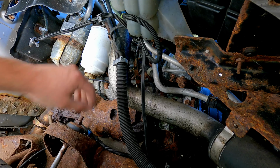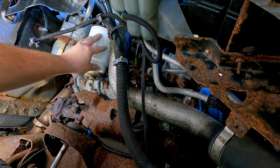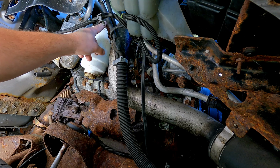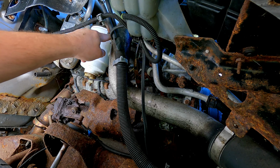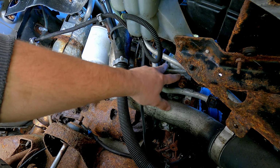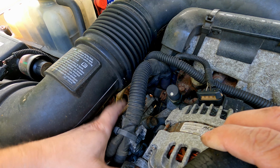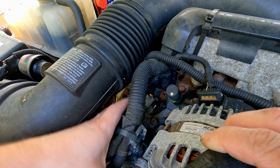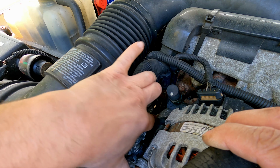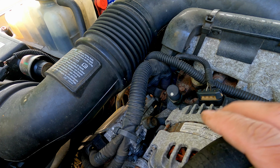Well, we're up underneath the wheel well now, and here is the fuel filter assembly, which is really nice and easy to get at. Here's the line that I was originally going to tie into, but unfortunately I'm going to have to change my plans, because that line comes down, goes behind here, and then hits this banjo fitting, which is some kind of electronic thing for a common fuel rail. And here's that electronic controller right here for the common fuel rail. So it comes from the bottom of that into the filter, and then on the top, there's another banjo fitting right here that runs across the top of the engine and over to where it comes from the tank.